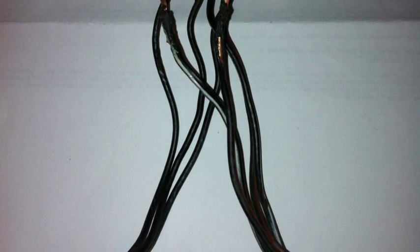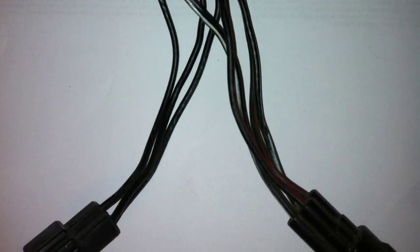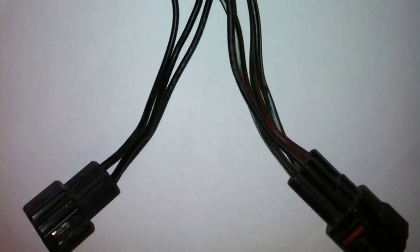So guys, that plug with the two positive feeds and two negative feeds is actually the standard wiring to the battery from the standard regulator. With the new MOSFET regulator rectifier, you get new leads that I'll show you later in the video where to run them down to the battery — hopefully that clarifies that. It's actually the plug on the right in this picture, which is the female plug that comes from the standard regulator. Anyway, carry on.